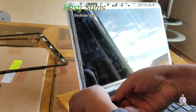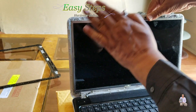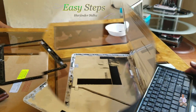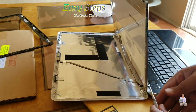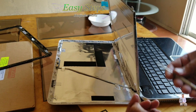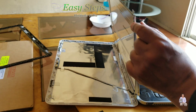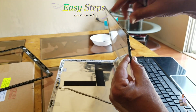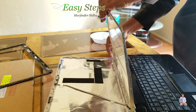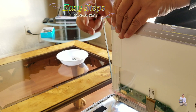After removing all those six screws, the bottom portion comes out. Now on the side, there's one screw here and one screw on the other side — we're going to remove those. That bracket holds the screen in place, and there's one on the top as well. Make sure you don't lose the screws — these are really tiny screws.